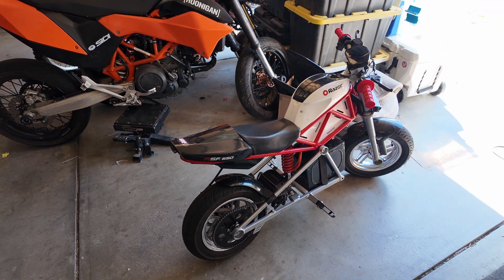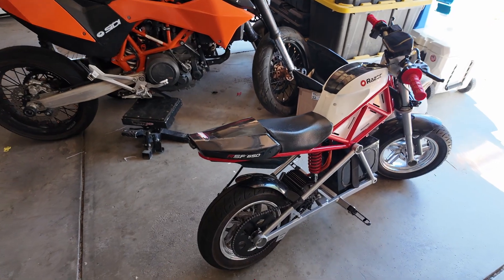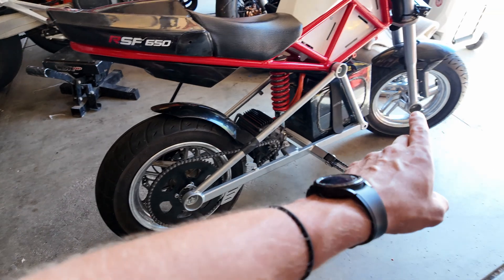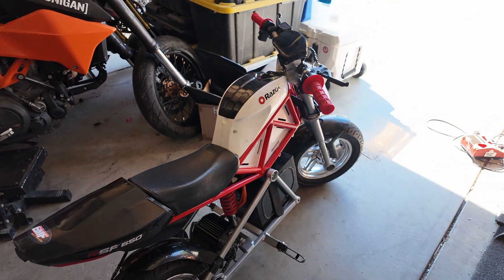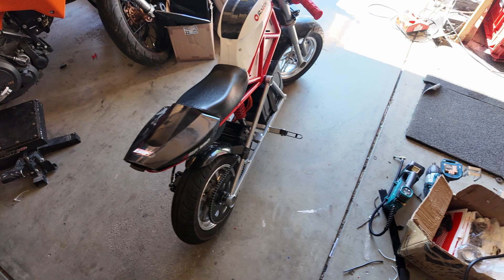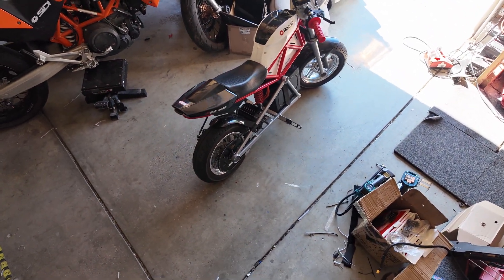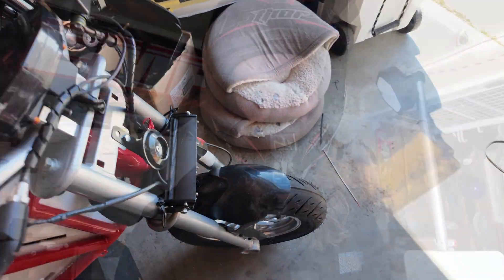Like always, we want to make sure our maintenance is good, but especially for times like this I'm going to make sure all my axle bolts are tight and my motor mount is tight. We also make sure our tire pressure is higher than normal — normally we run low pressure for wheelies, but for high speeds I want enough air in there.